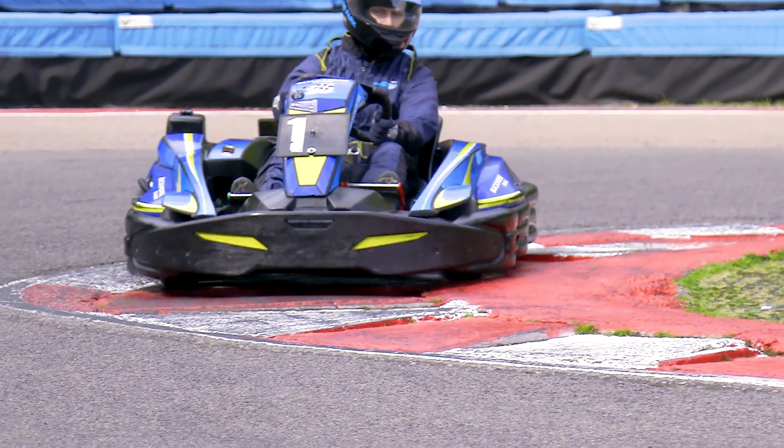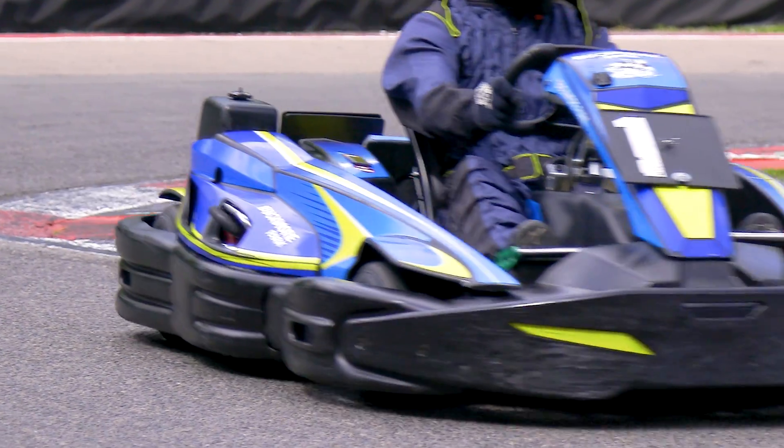In the grand scheme of things, the only thing we're really testing here is how much more heat is being generated in those tyres after doing those manoeuvres. Of course, there are going to be loads of different parameters which could change — tyre pressures, how old the tyre is, the type of compound the tyre is, and also the track conditions themselves. But we're just seeing if there is a massive increase in temperature, as it might be worth adding a few of these manoeuvres into your out-laps so you can get racing even quicker.